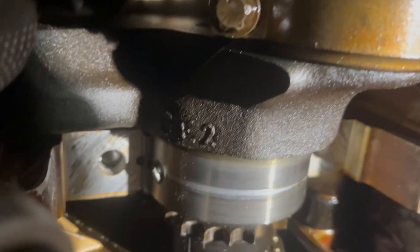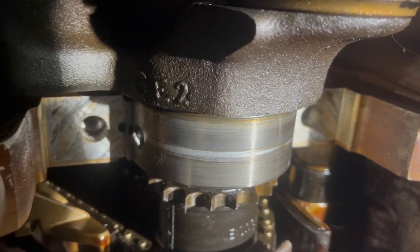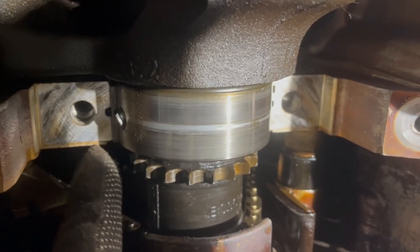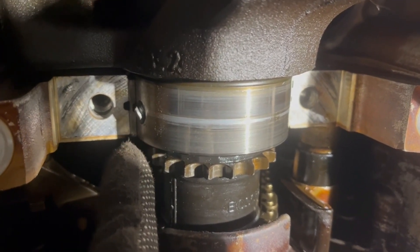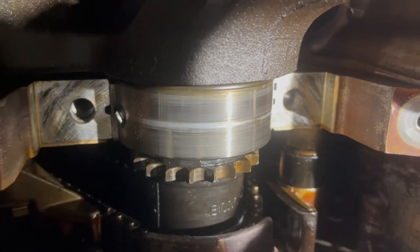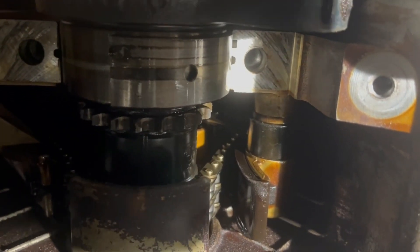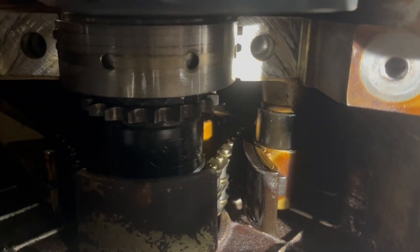So I'm now under the engine. I've put my screw in there, and if I turn the crankshaft, it should pass the block but take the shell with it — turning it out from the other end. Basically, turning it on this end, the shell should go out like so. Yes! Shell is out.